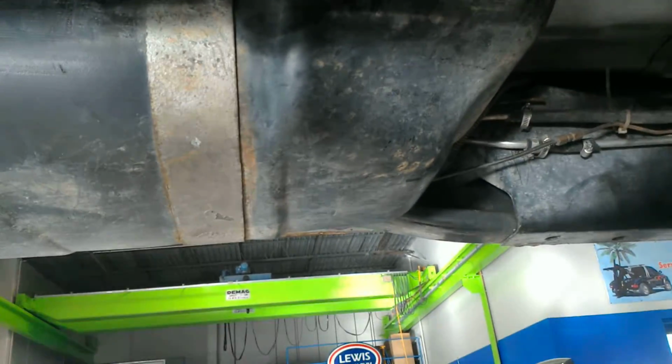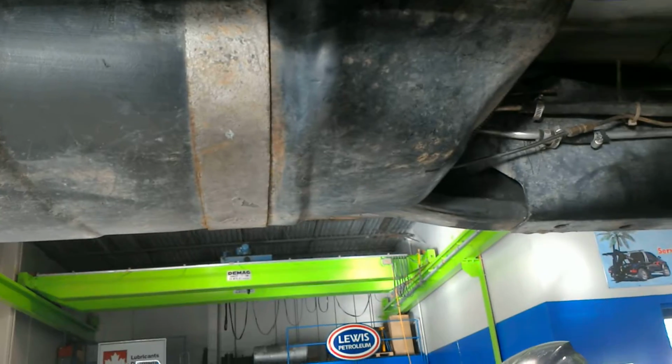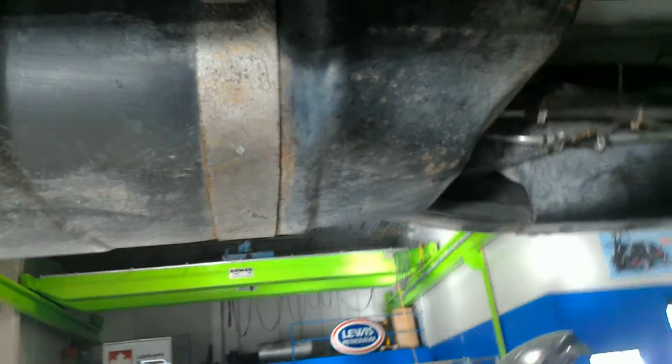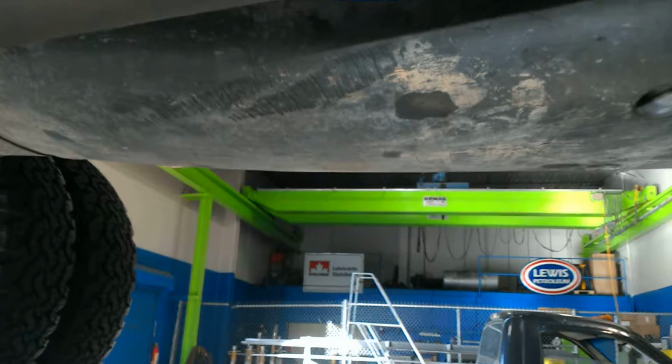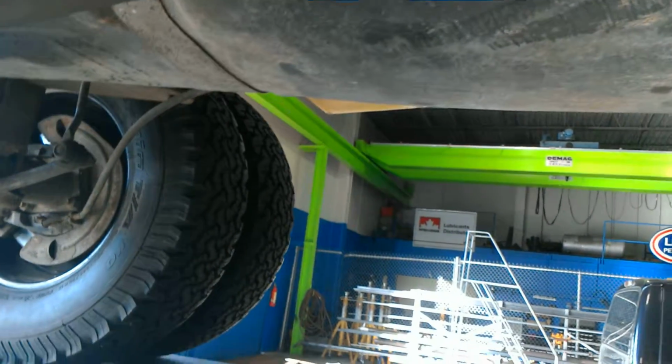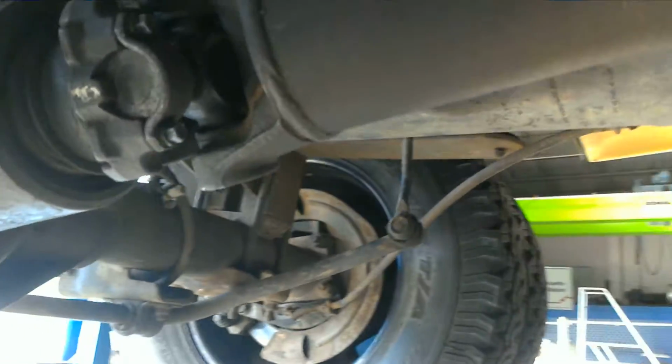You see if they're both going up, then you subtract the two. If one's up, one's down, you add the two together to get your working angle. It's very important that your working angle isn't more than 3 degrees on one side, and at a minimum of a half degree. That's the minimum and maximum that you want. You can use different angles to make it work, but if you want longevity, you want to go with that, especially being on a big rig.